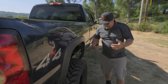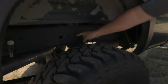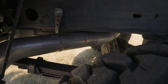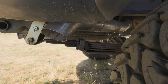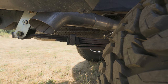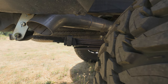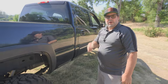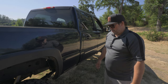One of the last things nobody ever thinks about when you do the shackle flip — take a look right here. You can see the exhaust coming through and over the leaf spring. Before the shackle flip the leaf spring was up a lot higher, so we had to cut the tip off and modify the rear exhaust. We did some mandrel bends and dumped it down right there, above the leaf spring. That's another couple hundred bucks to modify the tailpipe — when you do our shackle flip, you'll always have to do something with the tailpipe.